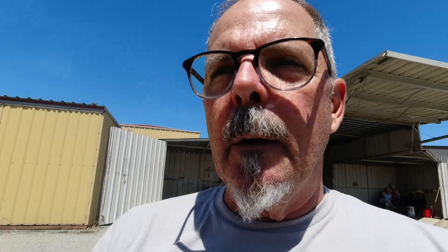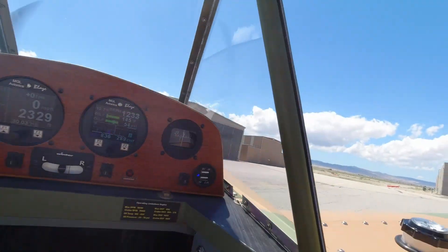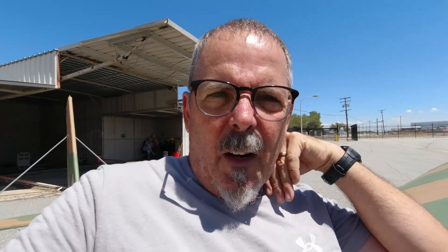My oil pressure was going a little bit over 70. I didn't push it any further — I'm going to wait until it warms up a little bit more and then try again. After the third run, at max RPM — anything over 2300 — oil pressure is running about 71. My warning light was coming on because I've got the range set at 23 to 70 and I'm running like 30 to 71. I'll have to ask Scott about the margin on that oil pressure.